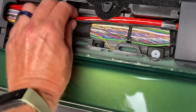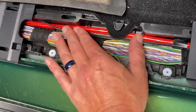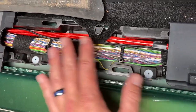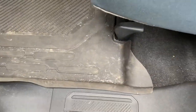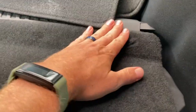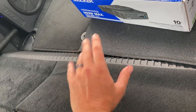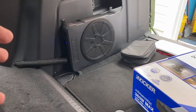Now you'll be running your power wire and your left and right driver-side and passenger-side front six-and-a-half speaker signal wires down this channel. I used the 18-gauge wire they provided for one side, and normal speaker wire for the passenger side since I had more of it — it doesn't matter, it's just speaker wire. I taped it at every foot or so. This panel pops off, this panel pops off, move the seat forward and this pops off too, giving you a clear shot all the way to the back.